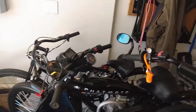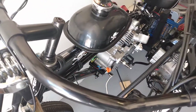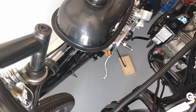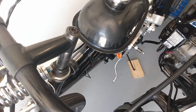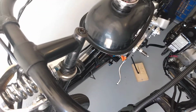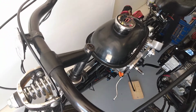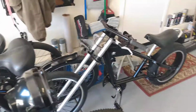I've almost got that 27.5 finished. I got a new bottom bracket. Can you see it down there? And a wide pedal crank for it. And my pedals are 1/2 inch and that needs 9/16. So I gotta buy new pedals. Whatever. But that's it. Throw the clutch and the chains on it, and it's ready. Oh, I got this stupid little OCC chopper bike over here I put back together. Painted it up. You can do wonders with paint.